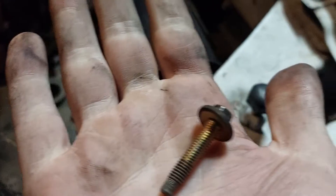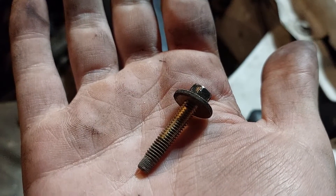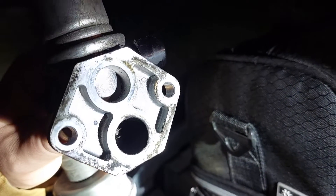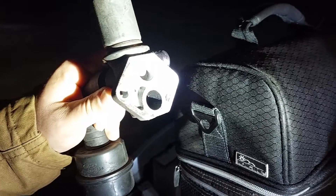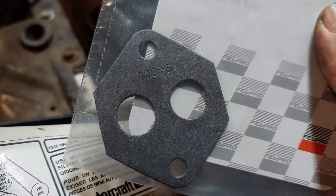Almost dropped it in the abyss. I don't know exactly what I saw back there that had Phillips, but these were 8mm, and I was able to take a box-end wrench and get them off. And over yonder here is our IAC — it's a little difficult to see because of the reflection from the flashlight, but it's kind of nasty, which is why I took it off to clean it. Using a mirror and feeling the other side of it, it looks like it didn't have a gasket on it, and that's never good. I got a gasket here — it's a 71216 — and this gasket goes for buckets and buckets of different Ford engines, so it's really common, really cheap, easy to get.